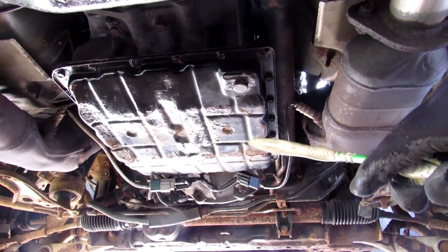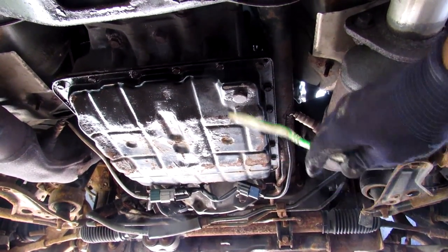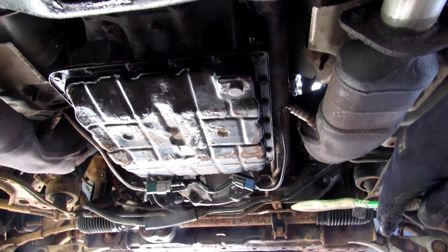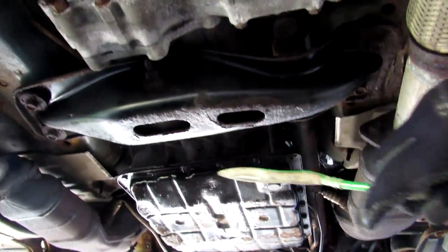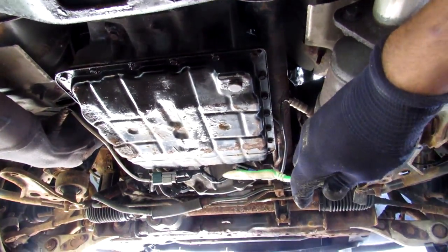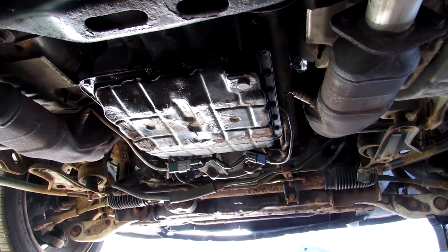It shifted really hard there. Now because this is a rear-wheel drive vehicle, the transmission is located underneath the vehicle itself and not near the front, so we're going to need to drop it down. Holding it on is this main bar over here which braces it against the body and the bell housing up at the front, but there's a bunch of other stuff we need to disconnect in the way.